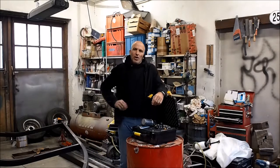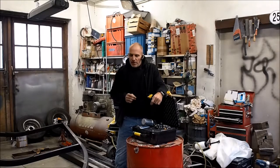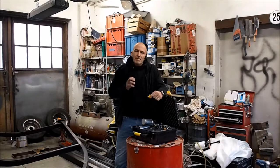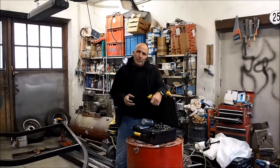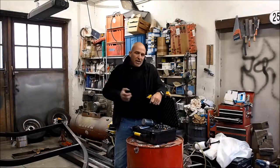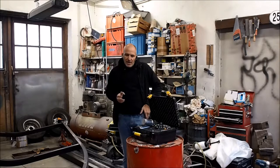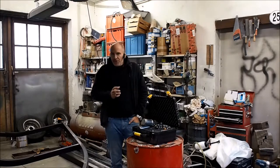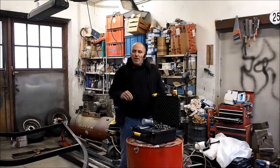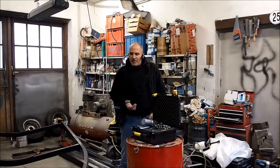So you put that base coat on. Of course, theoretically, you can use acrylic paint as well. If you do so, again, make a test and make a long-term test. If you put that acrylic down, give it all the time it needs so that the thinner can really off-gas and that it's really dry, and then you have to sand it a little bit again. That's the reason I don't use acrylic underneath flakes. So I always use a base coat. It dries really fast and you can immediately paint on top of it.